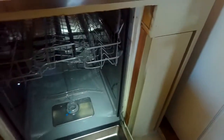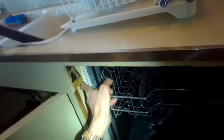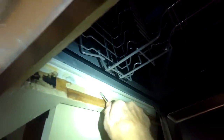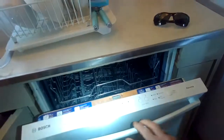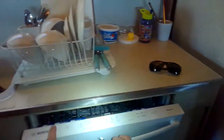I did notice that the dishwasher seems to be pushed in toward the back — it shouldn't be that far back, it should be a little bit more out toward the front. So I'm going to pull the dishwasher out toward me by about an inch and a half. If it's pushed back too far, the drain line behind it can get a crimp in it so that the water can't move quickly enough. That probably is what's going on — it was never really mounted in the cabinet correctly, so it got pushed back too far as it was being used.